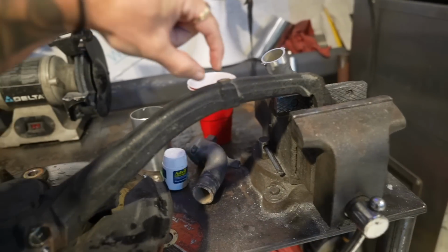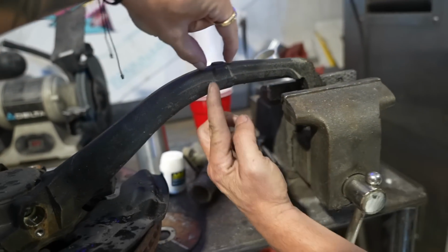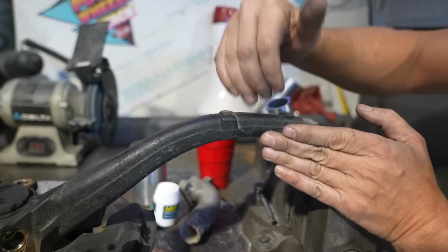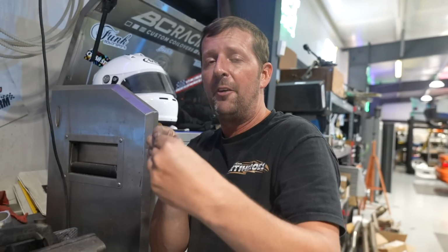Watching the video back that I did with Marco 3 years ago, we basically just took the square out, maybe a little bit more than the square. So I'm gonna do the fat side of it, because it looks like it's tapered. So if Marco cut more than that, I'm gonna do at least where the fattest nub is, and take out about an inch. Okay. That sound good? And then what we'll do is we'll bevel it. We'll keep probably a quarter inch of the inside of it square. That way it matches up square and we have the right angle. And then we'll bevel all the other sides around it.